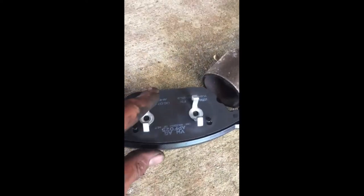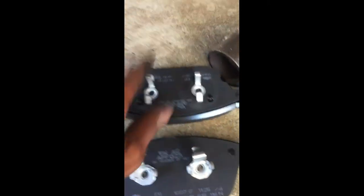These are your pistons — this is just the opposite side of the caliper, it's a straight hole. We're going to put these clips — see, they're different, right? These clips go in the piston side. Actually, I think these go into the piston side — yes, they pop in there. This side goes onto the outside holes right there. I'm going to throw that in there like that — I'm doing this one-handed, y'all. Bam, and there we go. Let's go ahead and get our bracket back on here.